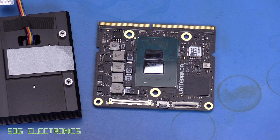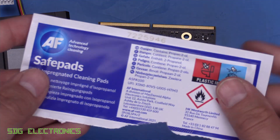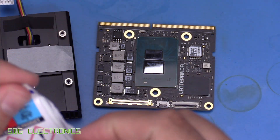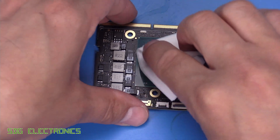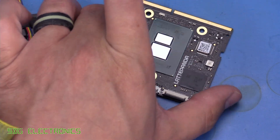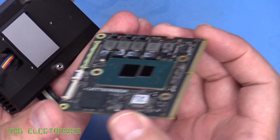I'm going to put the CPU cooler onto the CPU. There is some thermal tape already on the cooler. I'm just going to clean off the CPU because there's some grease on there. These IPA impregnated cleaning pads are really quite good — I'll put a link to them in the description but you can buy them from Amazon. They're lint-free cloths as well. So that's the CPU cleaned up. We can take off the pad and attach the cooler to the board.